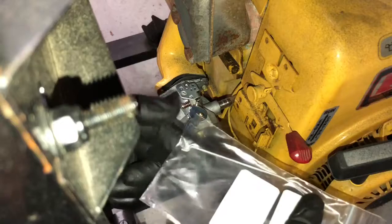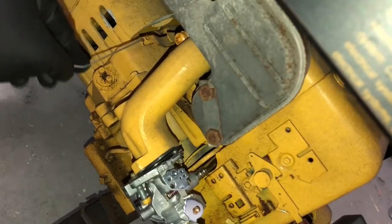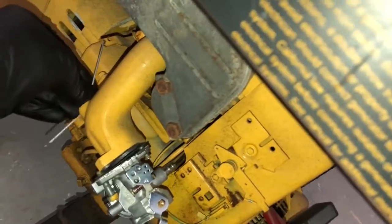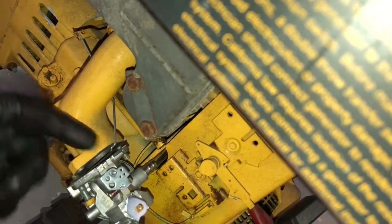After putting the fuel line on, you also have to put the governor link on. Put it on the outside one, angle it down, and just bend it underneath. And it's gonna come through here, and then it's gonna come out the top here. It's just gonna connect onto the top of the carburetor here. It goes in the middle of the three.